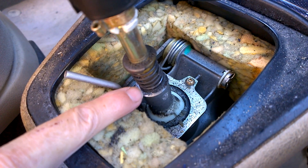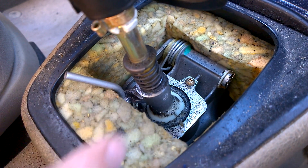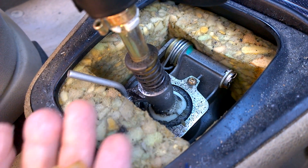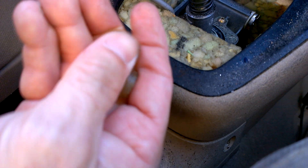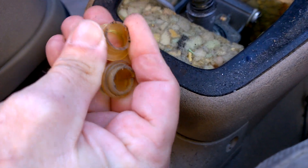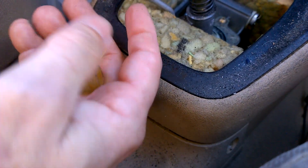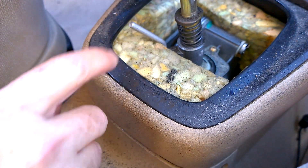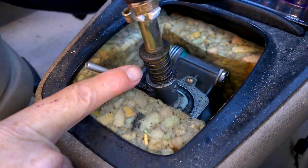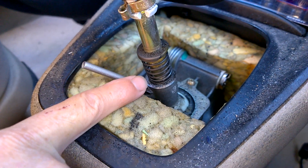You can see that it moves side to side a lot, and the bushings that are in there — these are some better ones right here. These are the bushings and you can see they're kind of squishy and rubbery, and when they get old they crumble and fall apart. You can see here it's pretty clear that this bushing is completely gone.